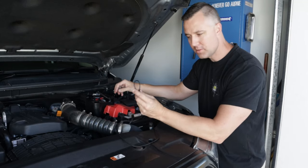Now what we're going to do is tape this cable onto the actual coat hanger itself. What I've done is doubled it over so that the tail, you can see that, is pointing backwards. Because this is the thickest part and it is tapered, hopefully that should pull through easier than if you're trying to put it through blunt nose in. So we'll tape this onto the coat hanger, and don't be afraid of putting on a good amount of tape, because when you pull it through there's quite a fair bit of pressure on it. So we'll give it a good wrap, tape this all the way on, and with a bit of luck we should be able to pull that through.